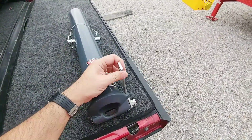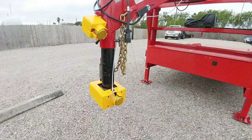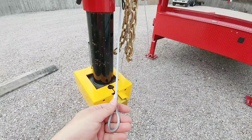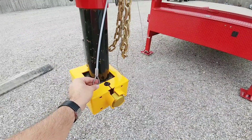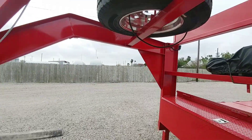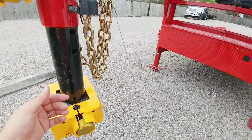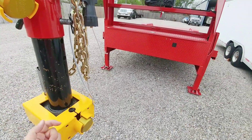In order for this to work properly and release it off the ball, you have to connect something to this lever right here. I've already run this cable — it's actually eighth-inch thick inside but with the wrapping around it it's quarter-inch thick stainless steel cable. It's routed up through some holes that were already in place, so once I pull on it, it will help me release the coupler from the back of the truck instead of getting inside the bed, lifting up, and manually releasing it.